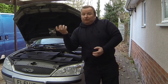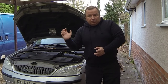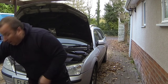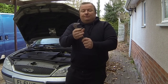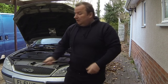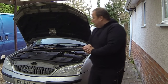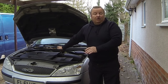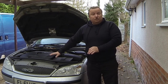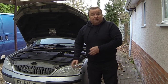That does require a 36mm socket to actually undo — it's a plastic bodied affair. I haven't got a 36mm socket, so what I'm going to be using are these side wrenches, which are quite deep along the blade, and I'm hoping to get to kick the cartridge open that way. There's supposed to be an engine shield underneath on the base of the car, but it isn't installed on this one. First of all, I'm just going to jack the car up in the air after I've warmed it up for about five or ten minutes.